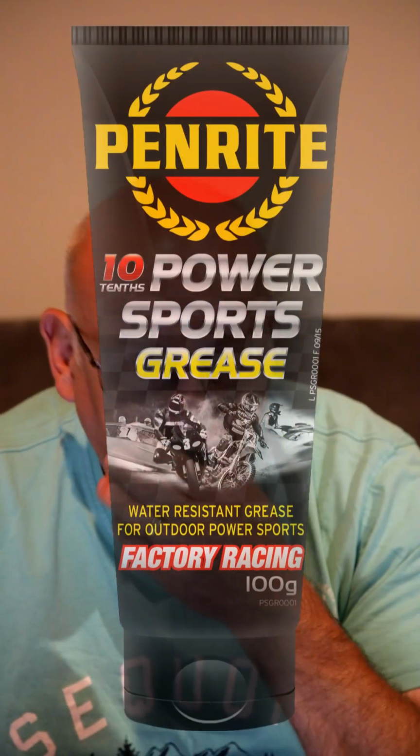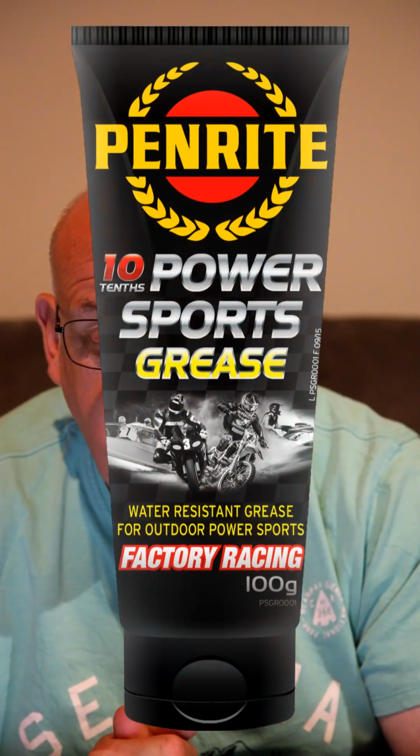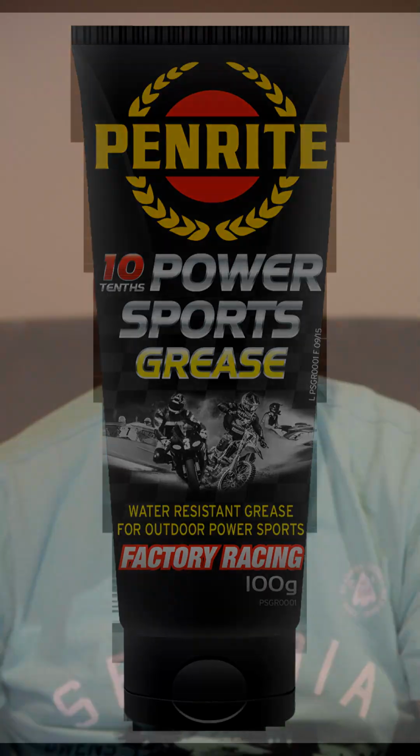So let's talk about the Penrite range. They've got 6 greases on their website. And the first one to appear is the 10/10 Power Sports Grease. Now, Power Sports Grease is a water resistant, high temperature multi-purpose grease that contains special anti-rust additive for enhanced protection against rust and corrosion. It also contains a tackiness agent to provide increased protection during severe performance conditions, allowing for exceptional water washout resistance and spray-off resilience.